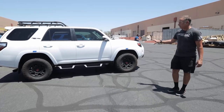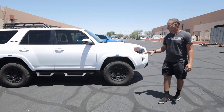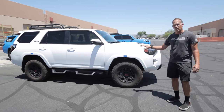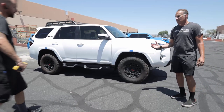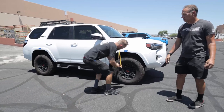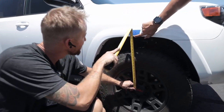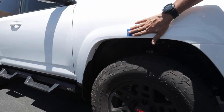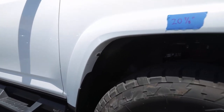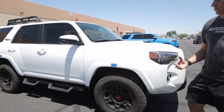This vehicle right here we're actually getting ready to do right now. What we've done is we've done some base measurements on the vehicle to show a starting point. We suggest everybody does this because it can vary vehicle to vehicle. We take a center point on the hub to the bottom edge of the fender and write down the before measurements. We do this on the front and the back, and you can also do it side to side to give you an idea of where you're going to end up after the lift is installed.